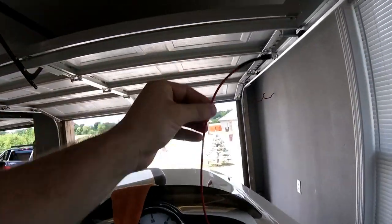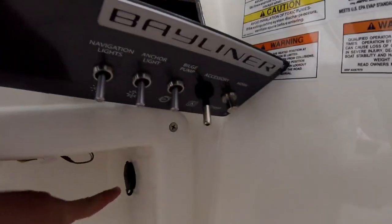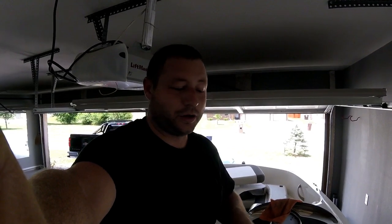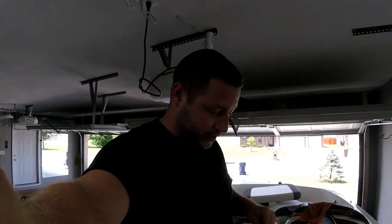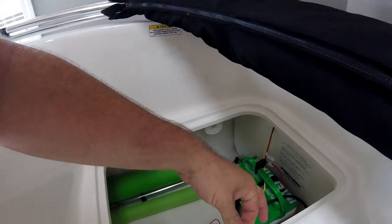We're going to wire that switch. To give you an example of my accessory wire, we're just going to run from the toggle switch to the 12-volt socket. I have a piece of wire, and on each end I have placed the proper connection and heat-shrunk it so it looks nice and clean. The accessory is going to go down to the socket. We have the accessory wire hooked up and the 12-volt socket in. Now I need to run the wires from the back near the battery up to the front. One nice thing about the Element is it's all one fiberglass hull — you can stick your head in under the back by the battery and see all the way up to the front. We're going to use a water hook and basically fish this line right up there.